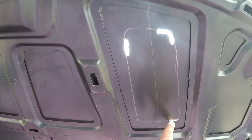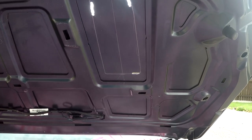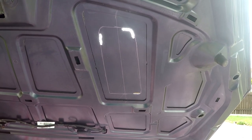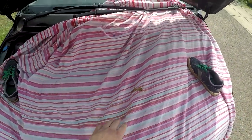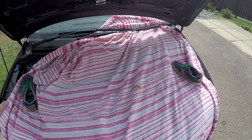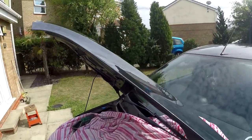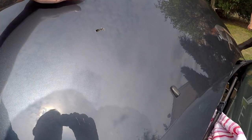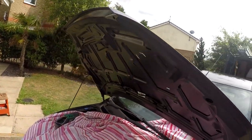I've used a drill and metal drill bit to make a couple of holes so I can fit the reciprocating saw in and just go across, up, across, down — done. It's a cleaner, safer line than using an angle grinder. Definitely still use safety goggles and gloves. Either way, cover up your engine bay because there's loads of swarf — you don't want that going in your engine bay. You can also put masking tape along the cutting line to help limit any chipping or damage to your paintwork.